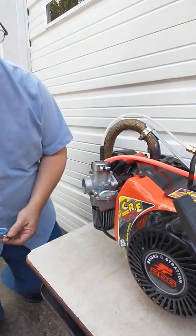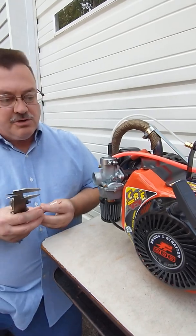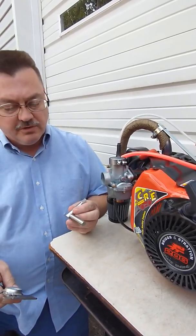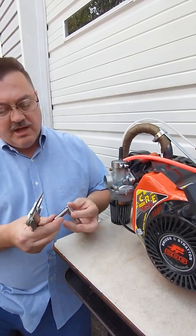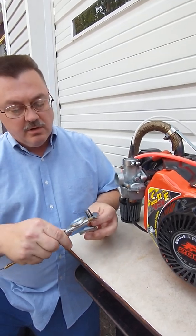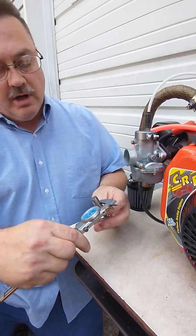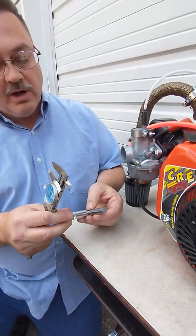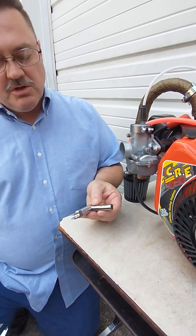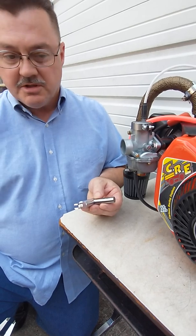This is a green slide restrictor plate engine and it should measure 490 thousandths no-go. This is the official tool that's used for the tech — as you'll see it has a steel pin — and we're going to verify its measurement before we go any further and see that it measures just over 0.491; in fact it is a 0.4915 pin gauge. That gives you about one and a half thousandths extra credit when it comes to the tech barn.